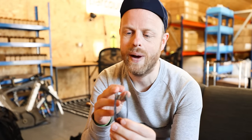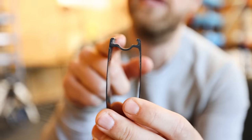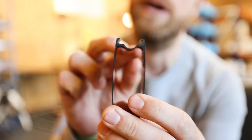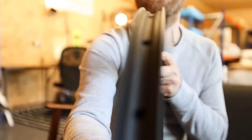The vast majority of clincher bike wheels have always had a bead hook — this little bit at the top of the edge here. You can see there's a hook that will keep the tire bead firmly attached to the rim. For a hookless rim we no longer have that, so you can see there's a smooth side to the rim. All that's doing is just removing the bead hook.